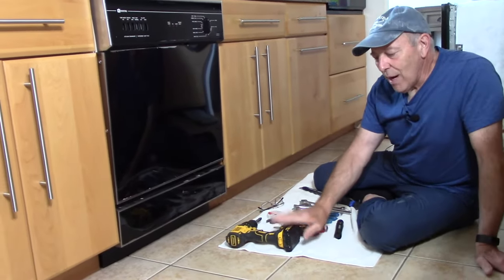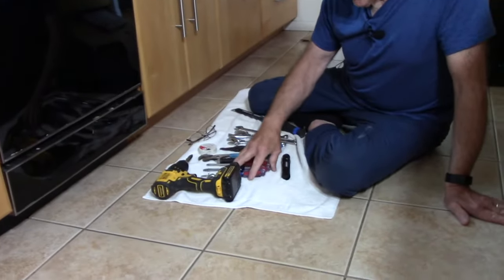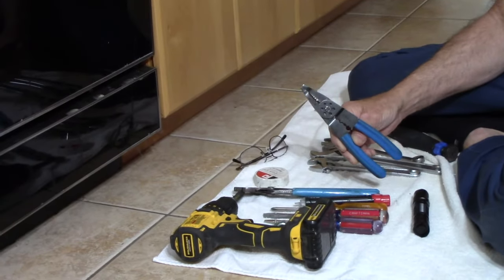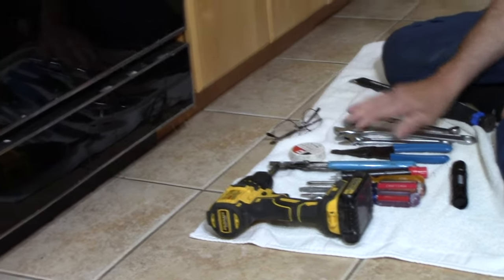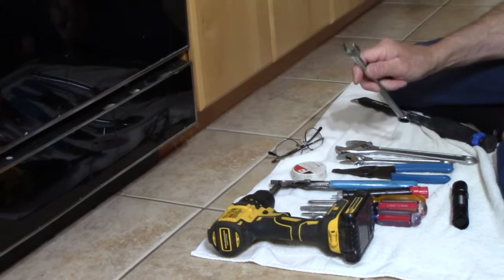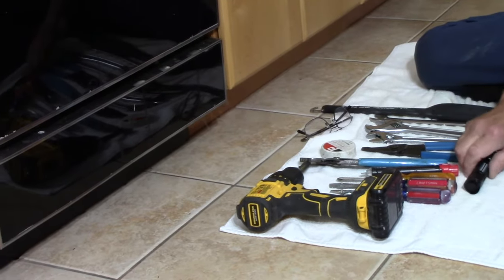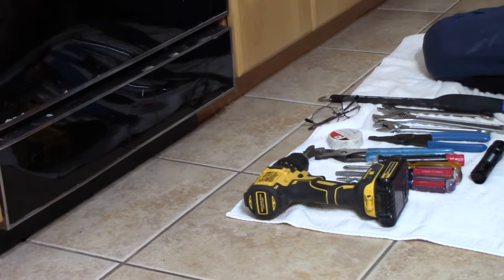Here's an example of the tools we're going to need - this is probably overkill but we'll talk about it anyway. We need a couple of screwdrivers, flathead or Phillips head, a pair of channel-lock pliers, something to strip electrical wires, some Teflon tape, and a couple of adjustable wrenches to disconnect the water supply line - I believe it's going to be 5/8. We also have a cordless screwdriver to remove the screws holding the dishwasher in the cabinet.